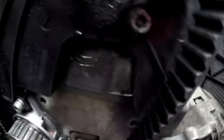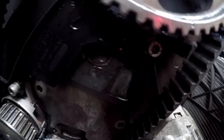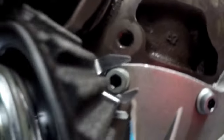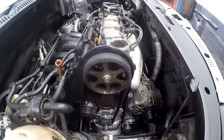We come back up and you can see the chalk marks on the crank are still in position — that's lined up. We'll come to the cam: the camshaft is basically also lining up. We just have to make fine adjustments to get it 100% at top dead center, and as you can see, the indent is right opposite the pointer. Our car is still timed properly. Let's check the pointer on the adjuster — that pointer is still in position. That means we have the proper tension on the cam belt, and that is how you time the engine on this Volkswagen Polo.